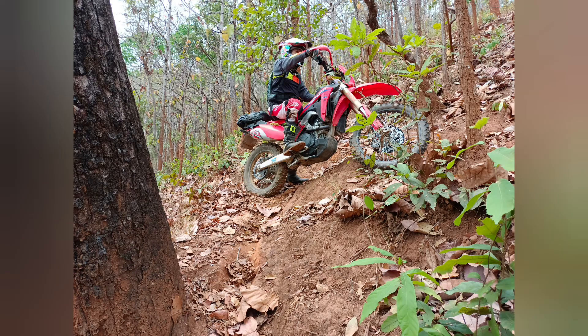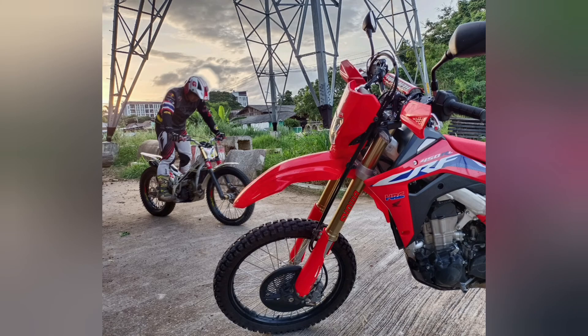So here is the crux of the issue: it's a big, tall, heavy bike, and if you want to do hard enduro stuff with it you're going to have to rely on your clutch control really heavily — you're going to need to get out some of that trials-style clutch technique. This is exactly what Pilar does — he rides the CRF450RL like a trials bike, which is great, except that the clutch is simply not designed for that degree of punishment. So sooner rather than later you're going to need a new clutch if you insist on doing hard enduro with this bike. In our case it was less than 3,000 kilometers.